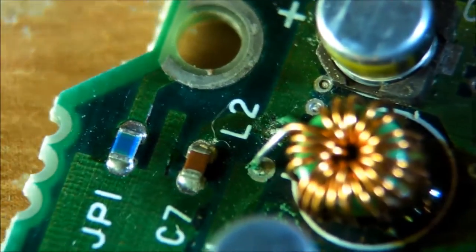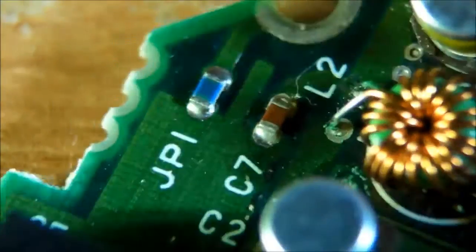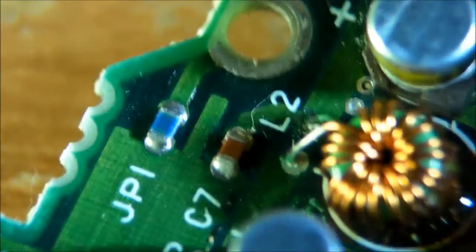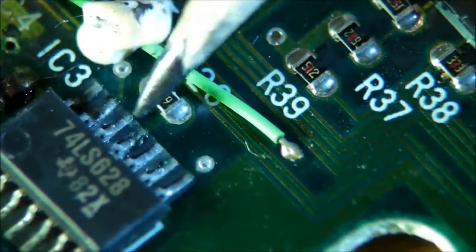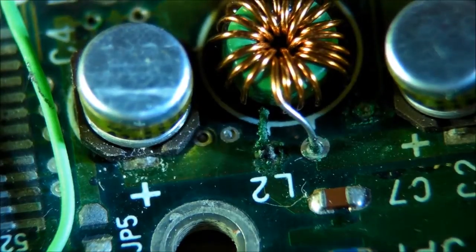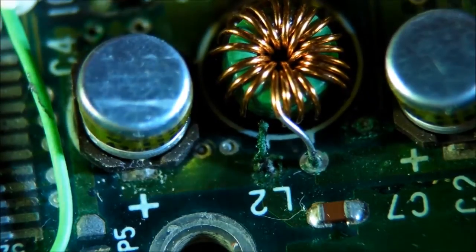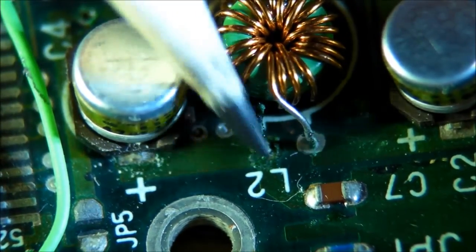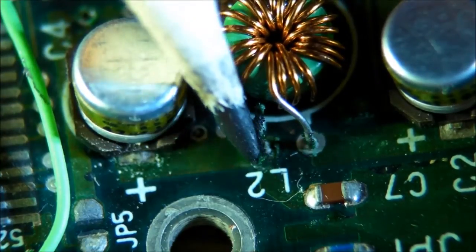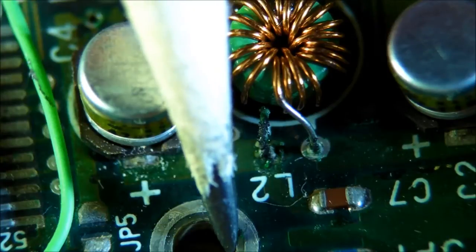And also at the wire here. It's kind of a green color down here at the base of the wire going up to the inductor. And this 74628 has some crusty pins on it right here. Here's a better look at that inductor. The first wire I pointed to, that one's fine. But the really ugly one is this right here. All that green gunk. You can see that tiny little piece that I managed to flake off of it.